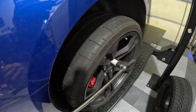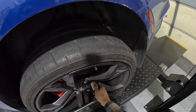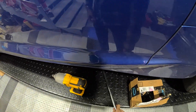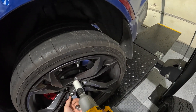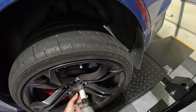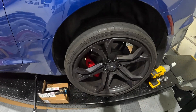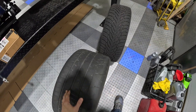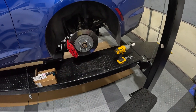Don't hesitate to use your body weight a little bit — you can kind of jump on it and that'll get you that pop, which is again a little terrifying. Make sure you're going straight down with it to get them loose. Then you can come in, be a NASCAR pit crewman, hit reverse, slap your socket on there, and buzz them right out. That's one loose 1LE tire — this guy will slide right off. Once again, you versus the guy she told you not to worry about. We'll soak this down with some silicone and get the new tire mounted up.